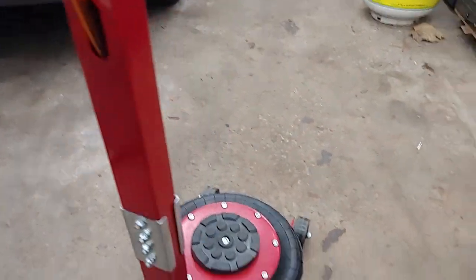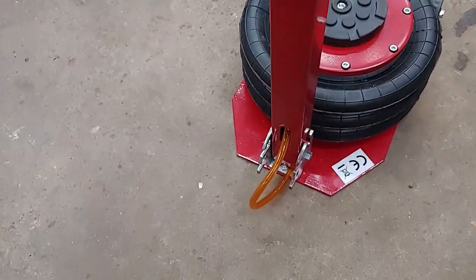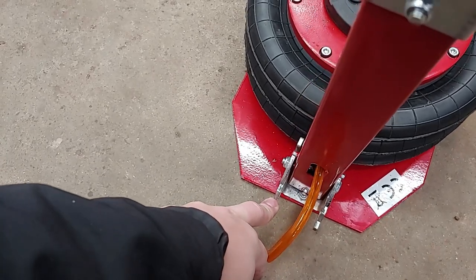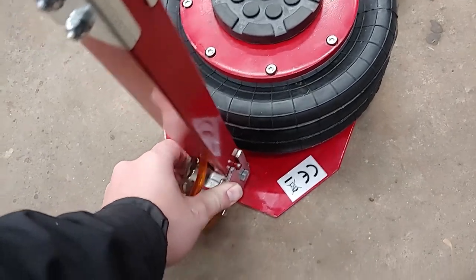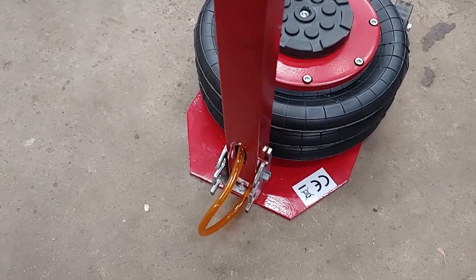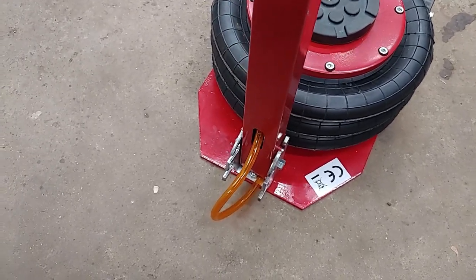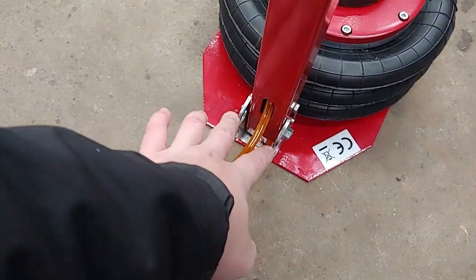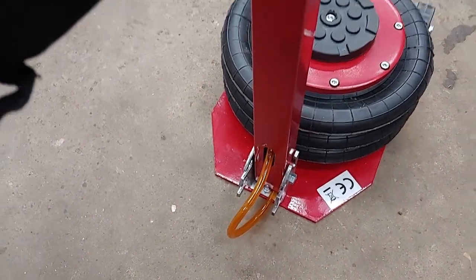This slop in the handle is not very nice. I might either remake this bracket, which is also not square — I don't know why, but maybe the guy was drunk drilling those holes and it didn't end up being square. I don't like the amount of slop in this. I understand there has to be some, but I think there's too much side-to-side slop. A few nylon washers in there might fix it. We'll see.